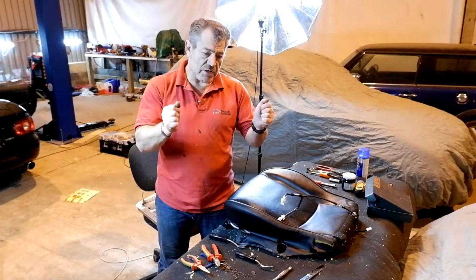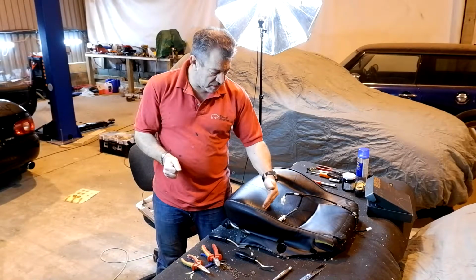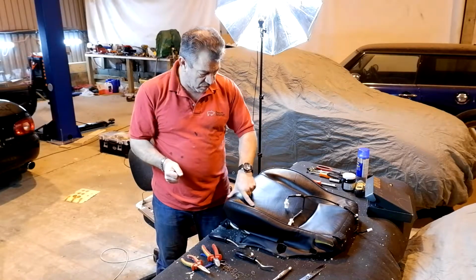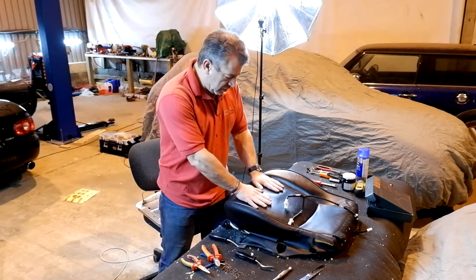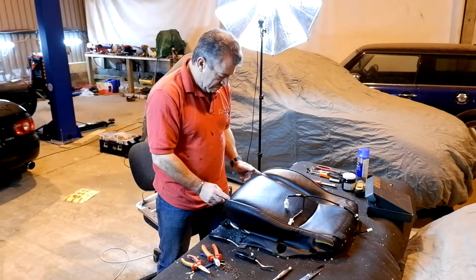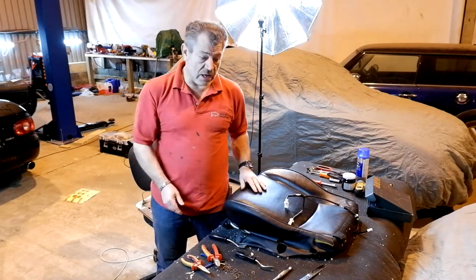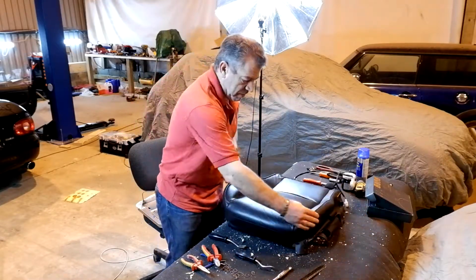And because you don't have any adjustment in the steering column, what I'm also going to do is strip back the top of this seat all the way back. I'm going to take a section of foam out to the front of here as well. So I'll actually show you that process, and that's to lower the front of your thighs down. Again, I'll probably speed a bit of this up, try and make it a little bit better to watch.